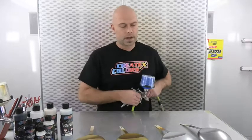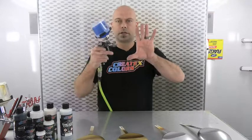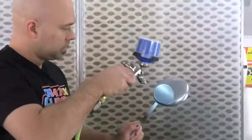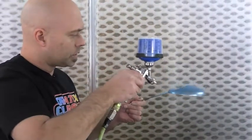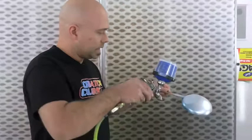When spraying candies, you want a nice even overlap — about 75% — keeping your gun constantly parallel to the surface. This is coat number one over the Quicksilver that's over black. You don't want to dry spray — you want a nice, even, medium wet coat of paint. Any kind of stipple is going to be magnified by that chrome. That's coat number one. You can already see that looks pretty cool. The reasoning behind the lighter concentration is you don't want to darken it right up and lose that metallic or anodized effect.